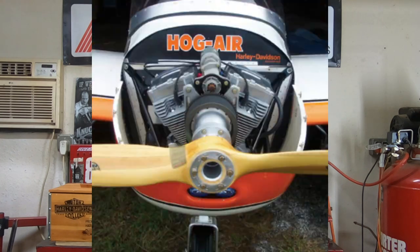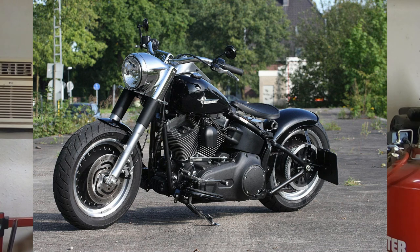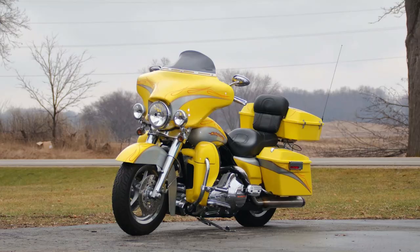By and large, the twin cam engine is a generally very reliable motor. They do really well. Are there some bad apples out there? Absolutely — there are quite a few. And if you do have an 88 or something, you're going to be changing the cam plate out and upgrading it anyhow. So it's up to you how far you want to take your twin cam. If you're not going all the way, be very selective with that cam plate and oil pump, and be mindful of that crank run out. Depending on how hard you ride and how many miles you've got on it, they do tend to develop more run out over time. So plan ahead so you don't waste your money on expensive parts that get torn up because of that.